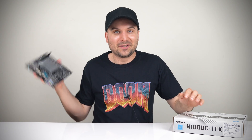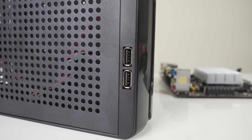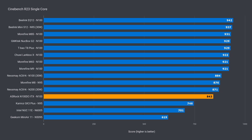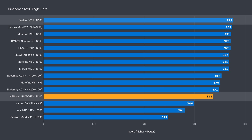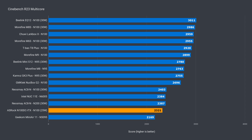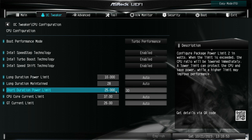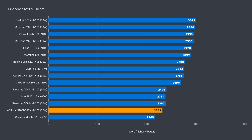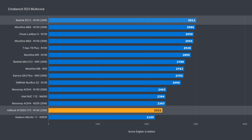I've reviewed so many mini PCs with Intel's N100 this year that I'm very familiar with its capabilities. In the budget mini PC space, fanless usually means worse performance. With a single core score of 843, the ASRock is at the bottom of the N100 CPUs — an 11% drop compared to the best performer. In multi-core, it's again at the bottom. The board, like most N100 minis I've tested, has a 25W power limit by default. I forced 30W in the BIOS and the score was even worse — thermal throttling. At 25W, it's trailing the best score by 23%.